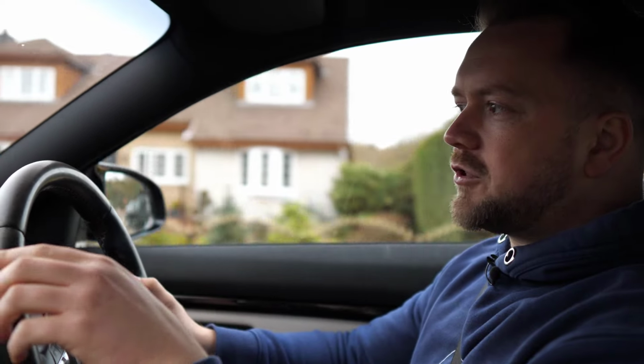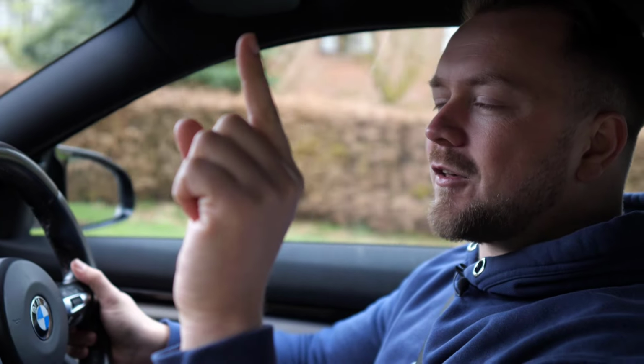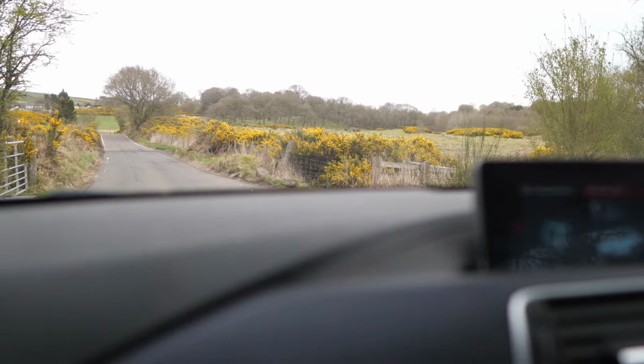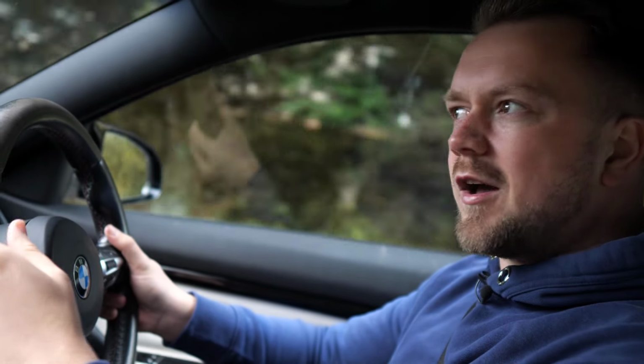Remember those oil leaks I told you about back at the garage? Well, that rocker cover one that isn't very visible when you're under that engine, thankfully you tend to notice it in here because the hot oil lands on the exhaust and you're going to smell it. So as well as keeping an eye out, also keep a smell out, I guess.